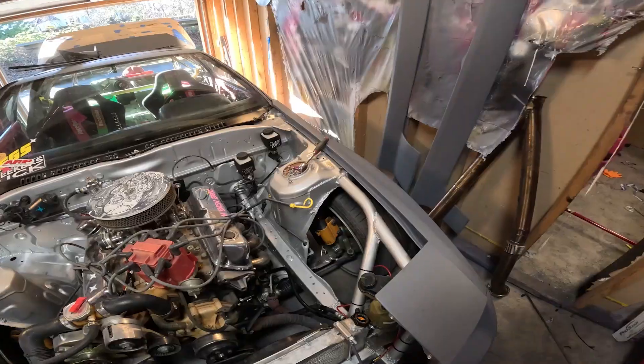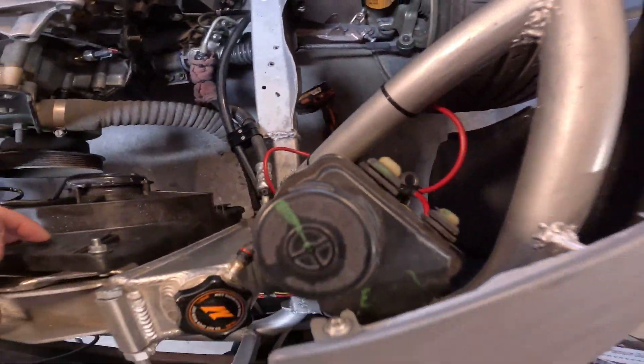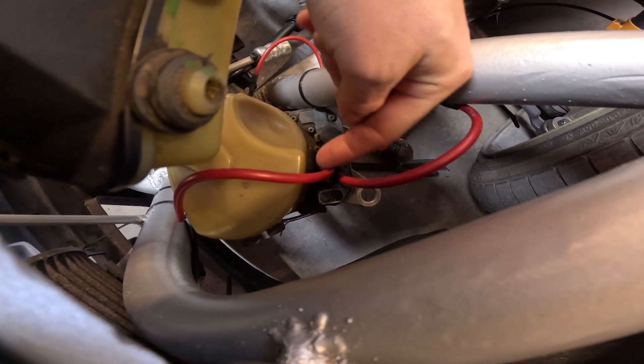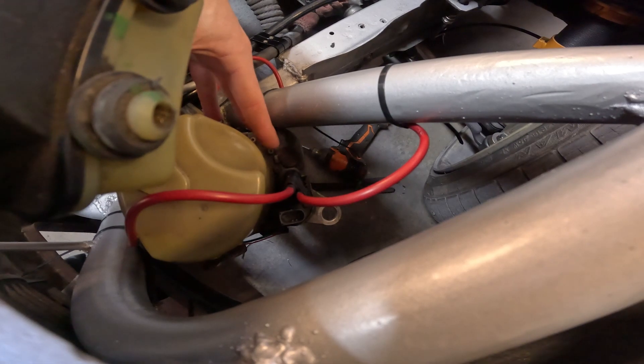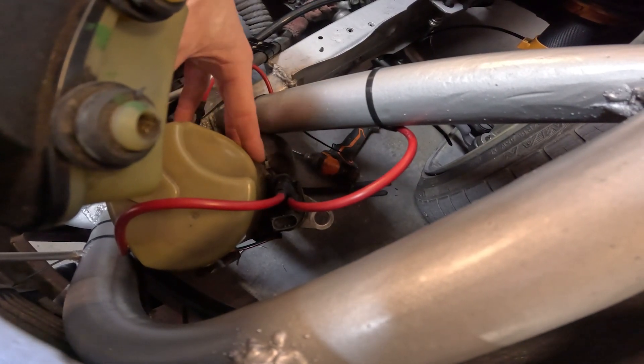More diag. So I jumped the gun a little bit. That connector — you can't even fucking see it — that guy is unplugged, down there. That guy. I need that. So this gives the pump power — like it has the power — and then that connector with the switch on it is what tells it to turn on and power.